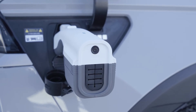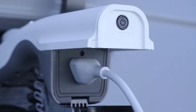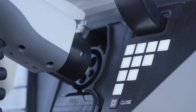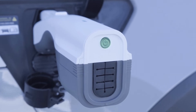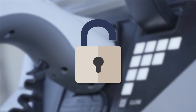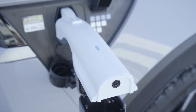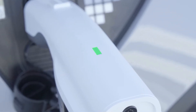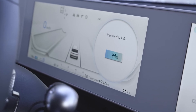This feature can also be used outside your vehicle. First, plug in your device to the V2L connector. Then plug the connector into the vehicle's charging inlet and turn on the connector by pressing the power button. The system will automatically lock the connector to the charging inlet while in use. When vehicle to load is active, the green light on the connector will illuminate and you will see a message on the instrument cluster displaying the current state of charge.